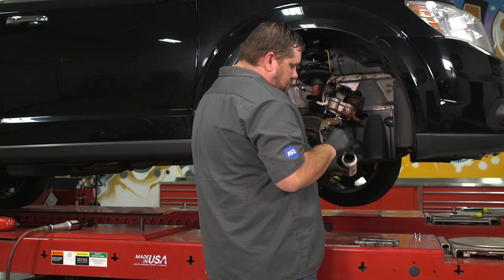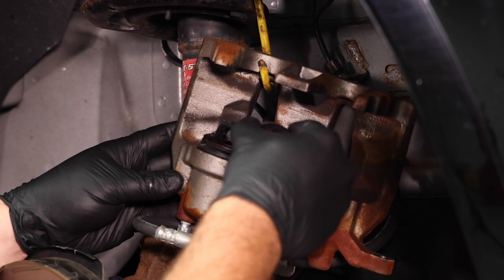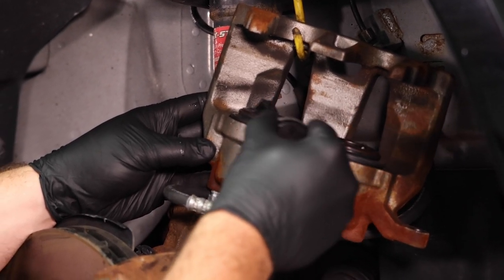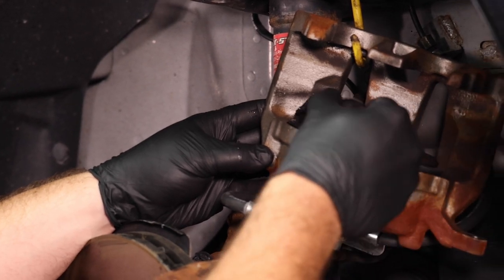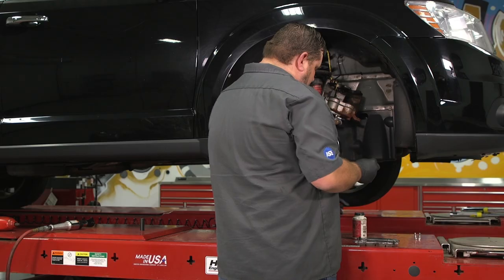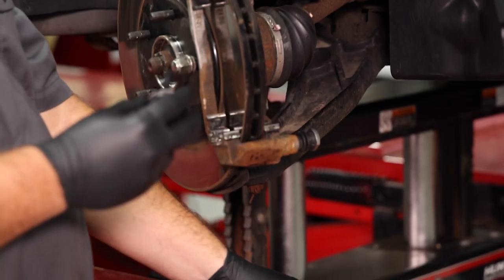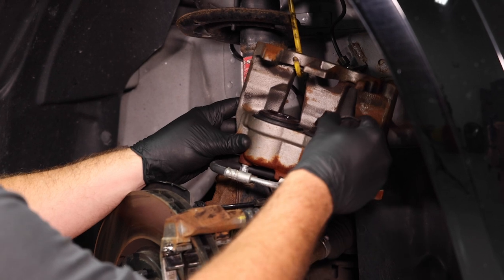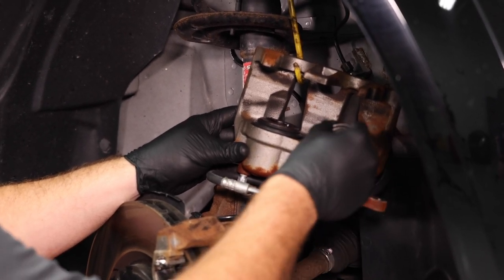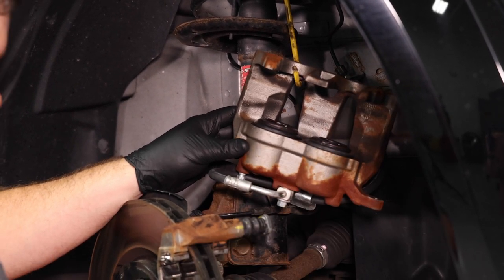This is a two-piston caliper setup, so I need to get both pistons. I'll apply it right to the face of each piston. This is another very important point to make sure you have the right grease — if I'm using a petroleum-based grease and I get it on those dust boots for the caliper piston, they're just going to swell up on me. That will actually end up hanging the pads onto the rotor and we'll have brake drag issues.